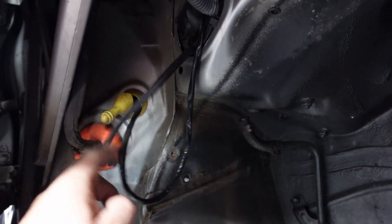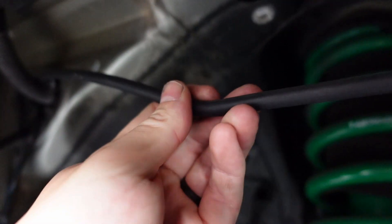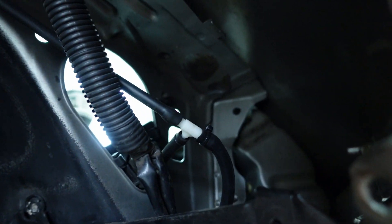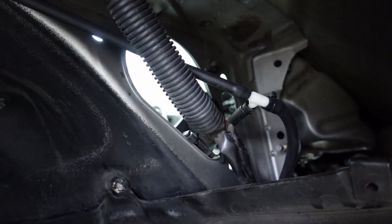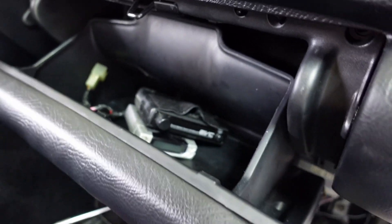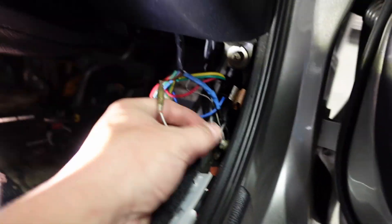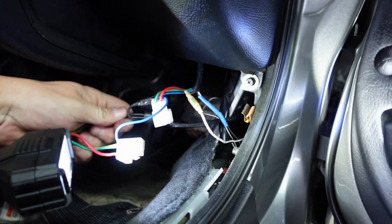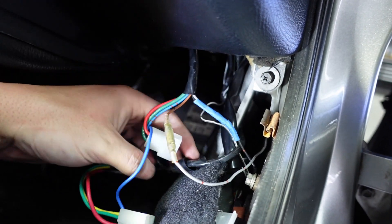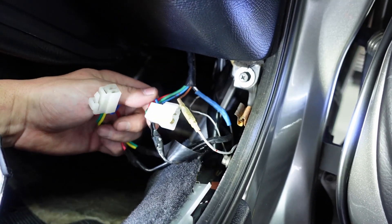Working inside here — we have to get rid of the FGO, the old school turbo timer, and boost controller. I've already got a couple disconnected. We've got the electronic valve controller here and I need to disconnect it down below. There's a lot of electrical tape in here. And that painter's tape — do not ever do that, please, for the love of God. Some of this is not perfect, and electrical tape I'm fine with, but that is a fire hazard. Do not do that — that's a no-no. No one's ever going to be perfect, but don't do that at least.